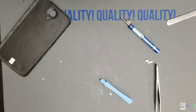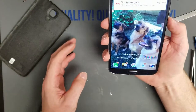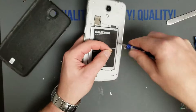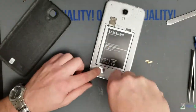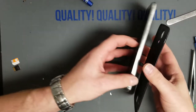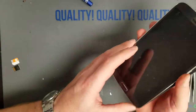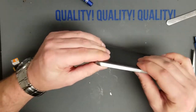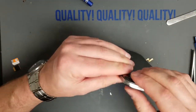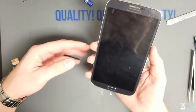So I had to take this back to my shop. Nobody has parts for a Galaxy Mega in stock because it's like a six-year-old phone. What ended up happening is I had to take a power button out of a Note 5 and make some modifications to it — with some copper wiring, solder to the contact points — to get it to fit into this phone. It worked, but it was way too much effort.